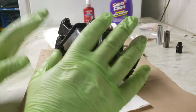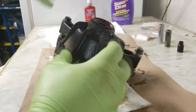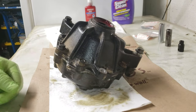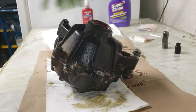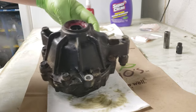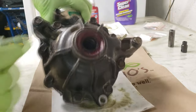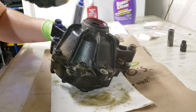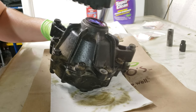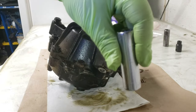The first thing you're going to have to do is take out all the bolts holding the two clamshells together. Take yourself an impact or whatever, grab a 14mm — there are two on the backside for the shaft that goes to the engine. Go ahead and take those out. Everything on this is already loose, so this is going to be really easy. Just put those to the side — that's it for the 14mm.